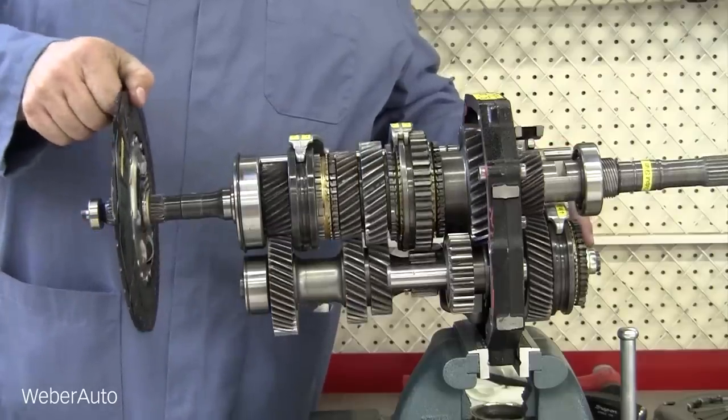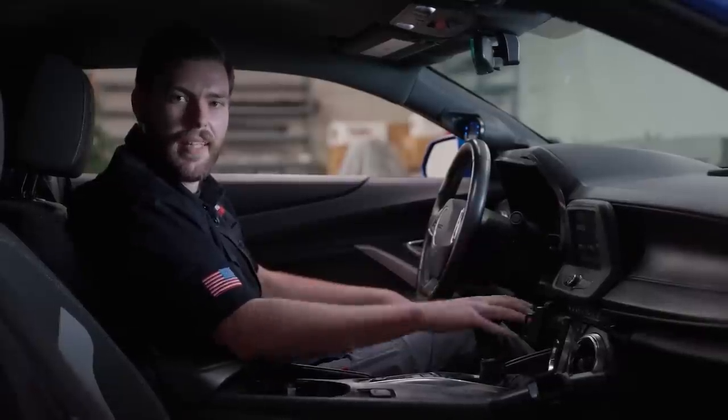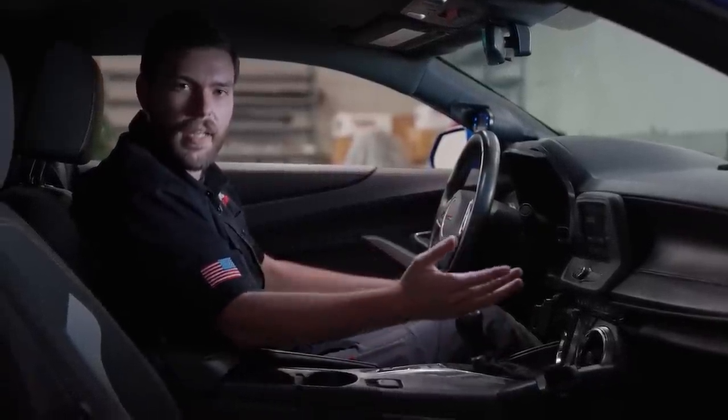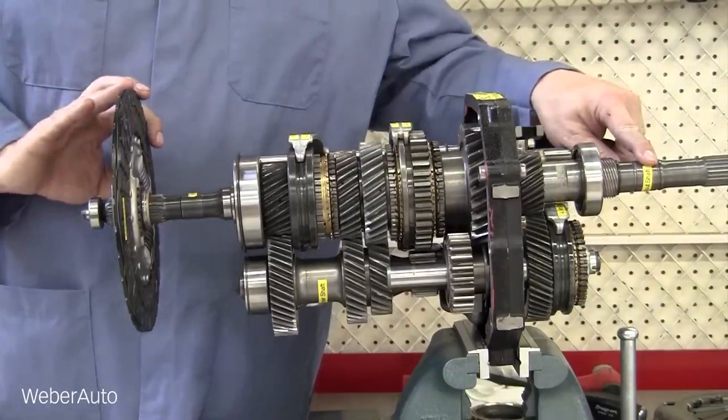When we talk about sweeps, we're generally talking about a single gear run. The best gear for a sweep is the direct drive gear — the gear that delivers a one-to-one ratio. This is where the transmission input and output are spinning at the same RPM, as though they were a common shaft. So in a 6-speed, it's typically 4th gear; but if you're in a 10-speed, it's usually 7th gear. With no torque multiplication, the transmission is contributing the least parasitic loss it can. In a higher or lower gear, the power output is no longer direct, and the power has to overcome more resistance from the rest of the gearing it passes through. The goal is to have the transmission act as a solid shaft from end to end, almost like it isn't there.